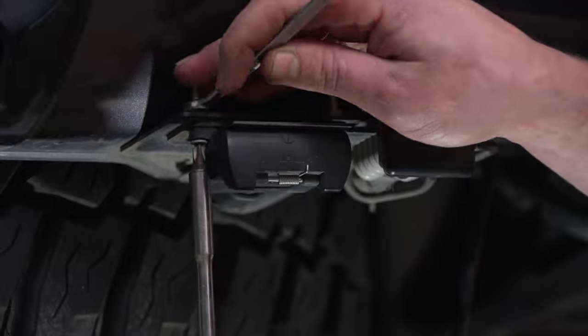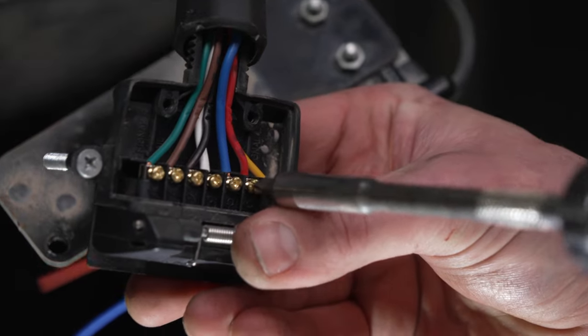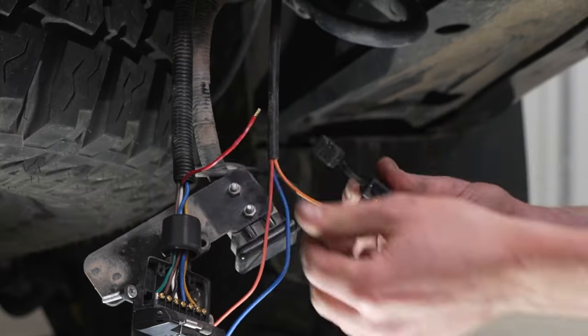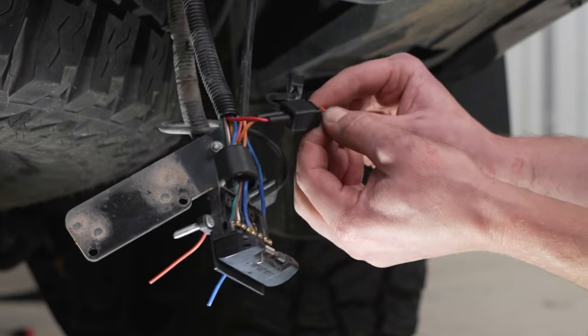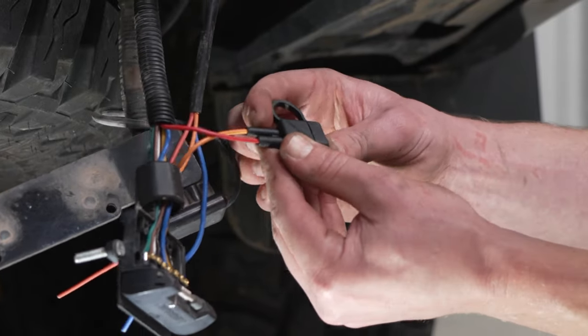Move to the rear of the vehicle to remove the trailer base from its mount and undo the cover to expose the wires. Remove the existing brake light trigger wire, which is the red wire at pin number 6, and pull it out of the wiring harness. Feed this wire into the supplied joiner — lift the orange tab, insert the wire, and push the clamp back down. Push back into the rubber boot and close the cap to seal.